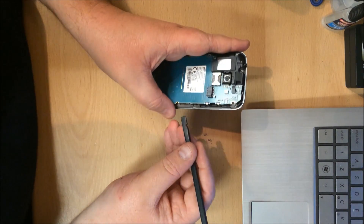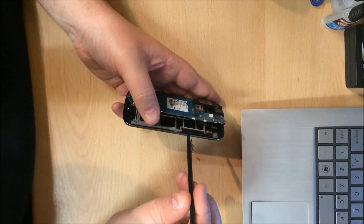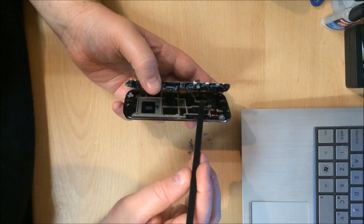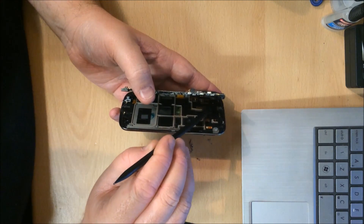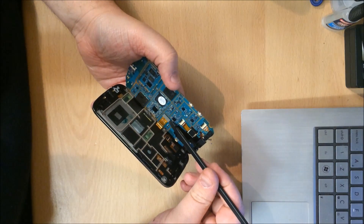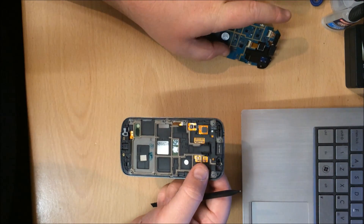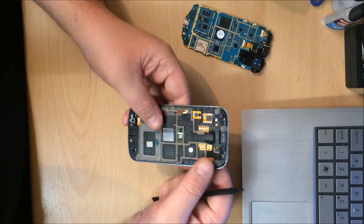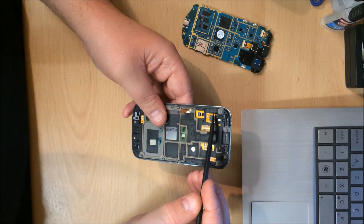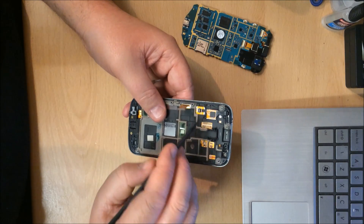The clip is just there. Gently open it up and then release the camera. The flex — the housing for the camera here — you just want to move it over so the camera comes out freely. There's a single connection there for the LCD, and that's your board taken out. This phone is quite similar to the other Aces where the flex from the digitizer comes through a gap, comes down and plugs into the main flex of the LCD, then connects to the board in just a single connector.